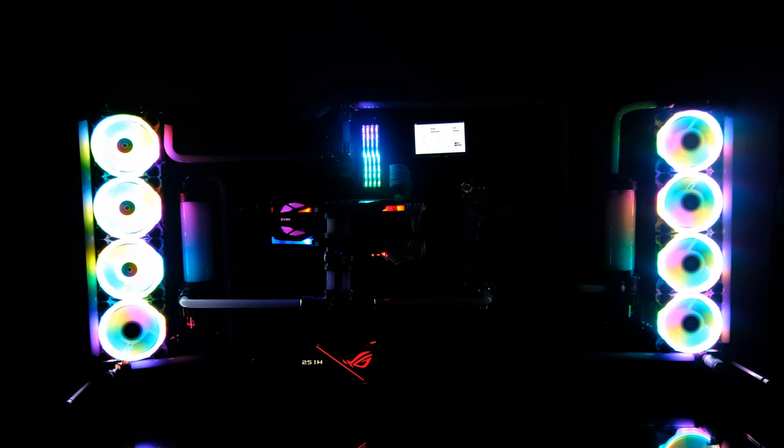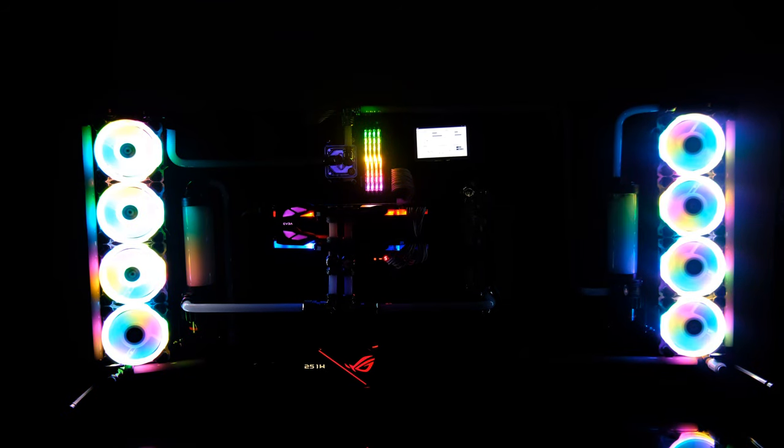What you've probably also noticed is I've got not one, but two 48 centimeter radiators, and I'm running 8 fans. So the cooling is absolutely fantastic, and it just really looks nice with the build. I really wanted to have something that would stand out, be practical, be ambitious, and also do a great job of cooling and keeping my parts cool, because I really wanted to overclock this rig. With the layout and the way that this build has turned out, I'm able to do that.